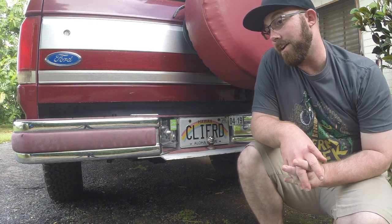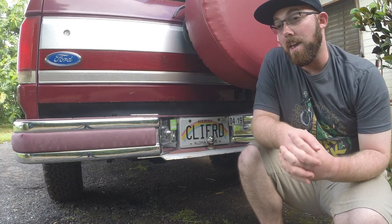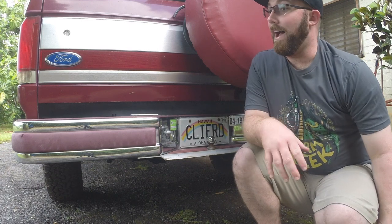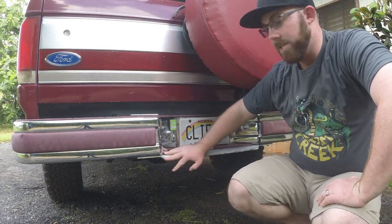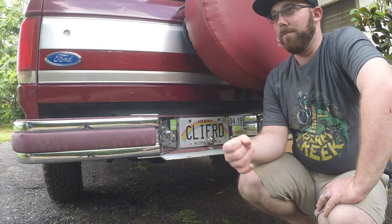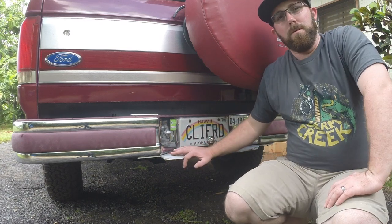If your vehicle came with a hitch receiver from the factory, it's a simple option — sometimes it's hidden behind a plastic cover, so take a look at the back of your vehicle. If you don't have one, some vehicles have a bolt-on kit available, while others require weld-on or special fabrication. You can look online or check U-Haul or Curt for options. For this truck, a bolt-on hitch receiver kit is about $150. If you want someone to install it, most U-Haul stores can do that. So budget around $150 for the receiver plus whatever you're willing to spend on the hitch rack itself.